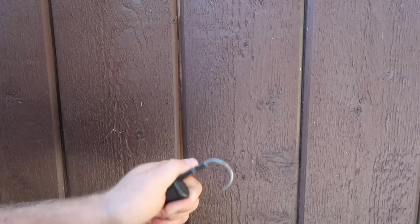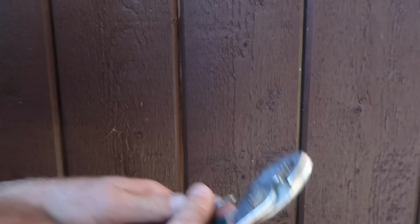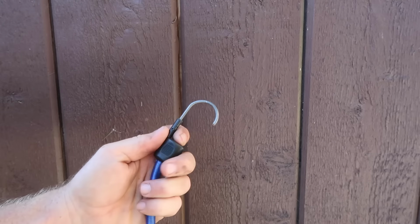I stripped the plastic off of one hook on each of the bungees and reshaped it to fit snugly around each rack arm. Then I tacked it in place so that it won't slide or come off the arm. Each arm is padded with self-adhesive nitrile foam tape. Unfortunately, the adhesive wasn't working great on the tight radius of the rack arms, so I secured it with hook and loop, aka Velcro, double-sided strap. I am quite happy with my results.